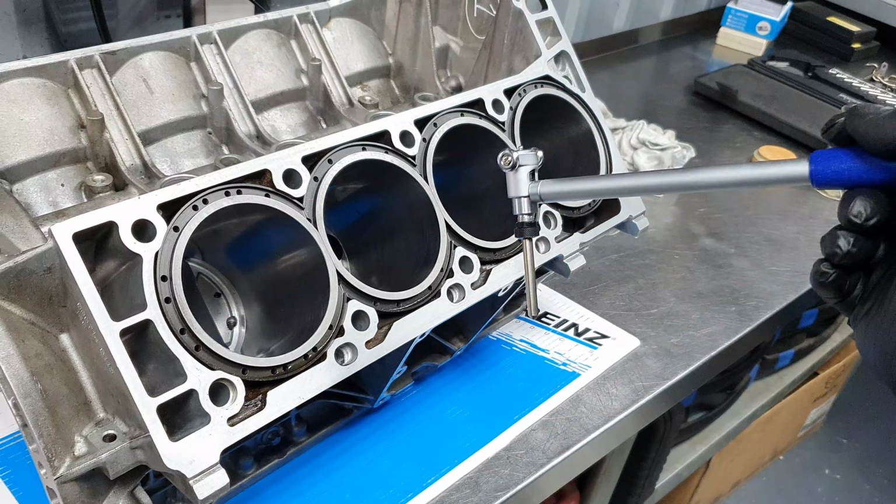So this one, it's not focused. All right, here you see that I need a couple of thousandths of a millimeter to reach zero. That means it's a little bit greater than 98 by a couple of thousandths of a millimeter, right? Which cylinder was that? This is the second cylinder. Let's go to the third cylinder. There, all right. Third cylinder. Yeah, similar, all right. Again, it's missing the torque plate, all right?